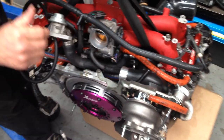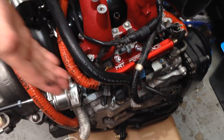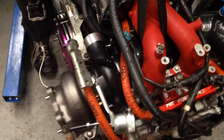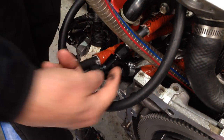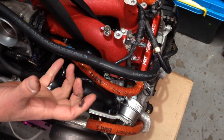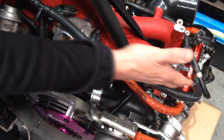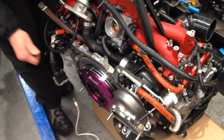I want to touch on a couple of topics from our previous videos. We're running split fuel rails on this engine setup, so we've got a separate fuel delivery line to the left-hand and right-hand side engine bank. You'll notice where the fuel lines come into the engine assembly — it splits from the original single supply. Remember, this car's running E85, and you've also got the return line as well. We've run a fire guard on top of all this to reduce the radiant temperature from the engine being absorbed into the fuel delivery system, to keep fuel temperature down for best performance.